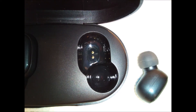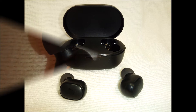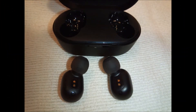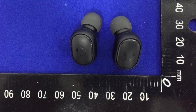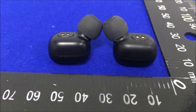The 19-inch flexible black USB 2.0 charging cable has USB-A male and micro-B connectors. The small charging case is convenient and lightweight — just the right size to keep in a pocket. This case has a micro-USB charging port. The case contains a 600 mAh lithium ion polymer battery with enough reserve power for 24 hours of earbud operation. Each earbud has a 43 mAh lithium polymer battery and can play 3.5 to 4 hours from a single charge. Earbud charging time is around 1 to 1.5 hours. The case charges in 2 hours. Once charged, the case has a 2-month standby time. The storage case not only protects the earbuds, it can also charge earbuds almost 5 times.